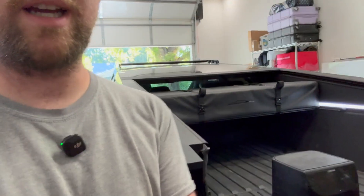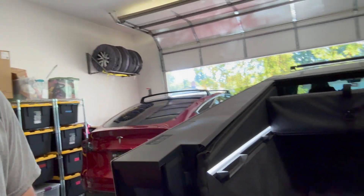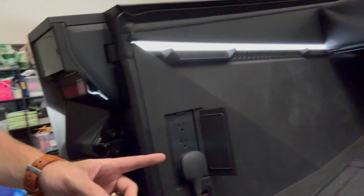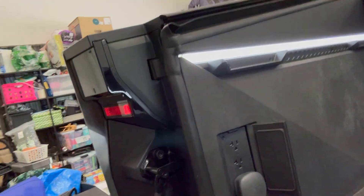Realistically at a campsite, you'd run an air fryer or electric griddle drawing about a kilowatt to a kilowatt and a half, plus power Starlink in the cab or charge your laptop and phone — Cybertruck is perfectly capable of that. Once you get into higher-power continuous devices like charging a vehicle, you need to be a little more mindful of that 9.6 kilowatt output limit.